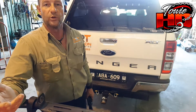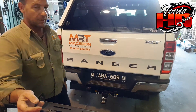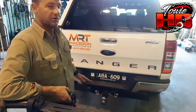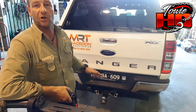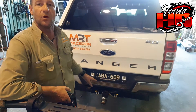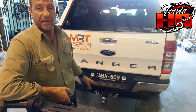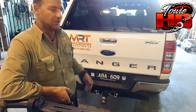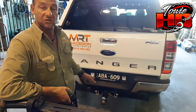When we look at the rear of our vehicles, I've got my tow bar in there at the moment and I actually have two tow bars — one that slopes down and one that slopes up. I've got a tow bar for each trailer that I need to take, but that's all I'll use that for. I won't use that to pull anybody out, and I won't use that to latch onto a tree if I need to when I'm winching somebody out. It's not what it's designed to do.